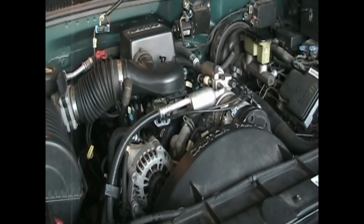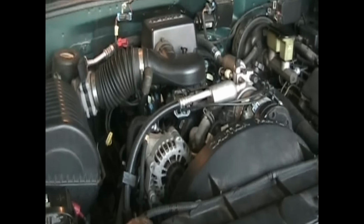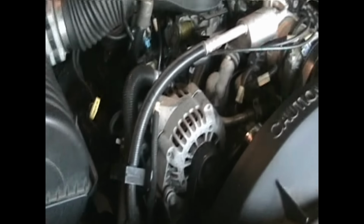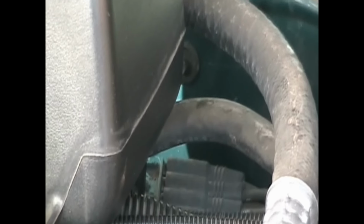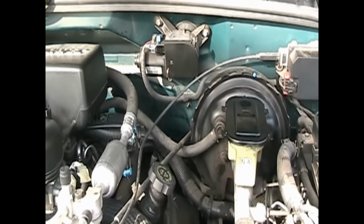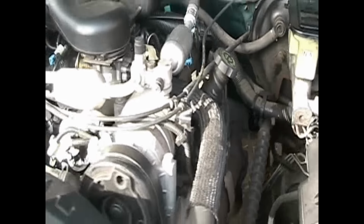Ready? That was it. Yes. Okay. Excellent. Well, leaving that vacuum booster hose off right there really caused a little bit of a scare for me when it would start but not stay running. Anyway, once that was connected back up, it started up fine, stayed running, and it's looking good so far. No leaks, it's all good.